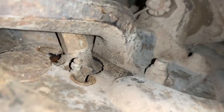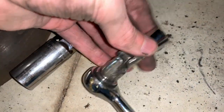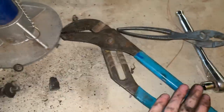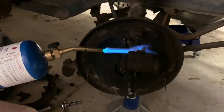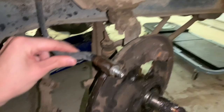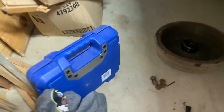I got the two bolts loose back here — I had to use a U-joint to get in there, it's really difficult on the front. Now I can pull it out, but we still need to get this brake line undone. I expand these all the way and try to get that loose. We couldn't get the brake line loose from the wheel cylinder, so we're taking a blowtorch to it because heat fixes everything. After we heat it up we're able to take it off.